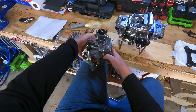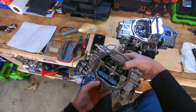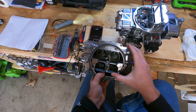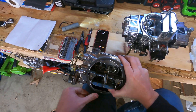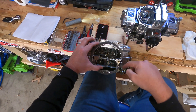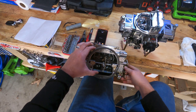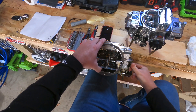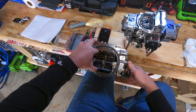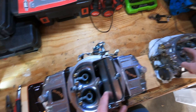This is also how the choke works on an Edelbrock — similar to this. Mine wasn't riding exactly on the cam, so that's fully open. This is an Edelbrock 600 CFM electric choke carburetor. You can see the big differences — it's got a lot more space on the sides where air doesn't actually go into the carburetor; it just gets trapped in there. Also, the main throttle area for cruising is also smaller. Versus on the Brawler, this has different venturis too — four down legs, a lot less restriction through the carburetor.